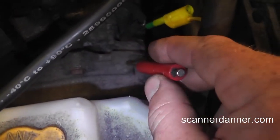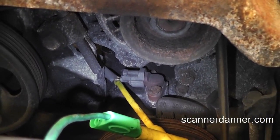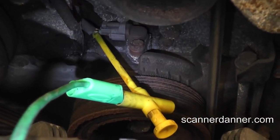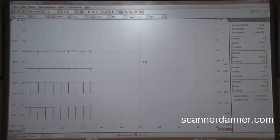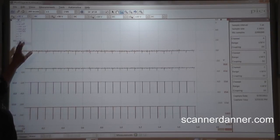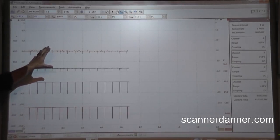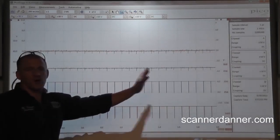We're right next to the battery. There's your camshaft on the left side of the engine, driver's side. Cam sensor sits right above that — we're just back-probing it. Crank sensor was a little bit more difficult, mainly because of where the harness was. We are clipped in on the signal wire and that sits right above our harmonic balancer. So go ahead and turn the key on. You see our coils firing again. We were on a 20 volt scale before, so they looked bigger. I'm now at a 50. And what we see right away is we don't have any cam or crank signals here. What we do see are spikes that are occurring in the cam and crank signal wires that are timed exactly with our coil firings.